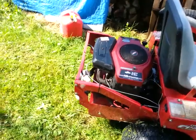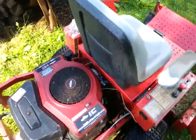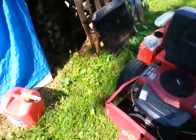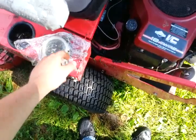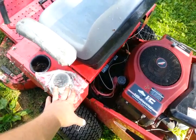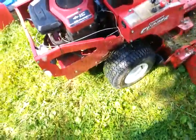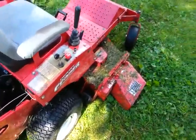Since we're going to be selling this lawnmower, we're not disabling any of the safety features, because that's just opening yourself up for a lawsuit. So this thing's about ready to go. We've got to get that gas cap in — I ordered it on eBay, so that should be coming. I don't know how much water is getting in the fuel tank; I'm sure that saran wrap on there is not completely sealed. It used to suck down when you started the engine because of the fuel pump pulling fuel through, but it doesn't do that anymore, so it's got to be leaking somewhere. Those gas caps are kind of expensive — about $20. It's got the big three and a quarter inch fuel cap.